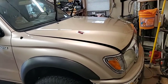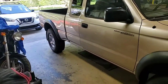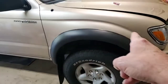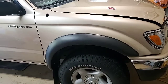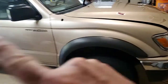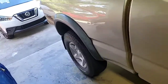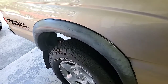As you can see after a one-step polish, the thing has almost resurrected itself — looking pretty darn good. For a lot of people they would say that's good enough, and even though it had those white tiger stripes on it, it cleaned up really well. We are going to go back and restore all the plastic and rubber again. This piece back here for some reason didn't clean up as well, but it's not a big deal — I'll be able to fix that right up.